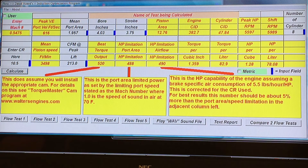In this instance we are calculating the Mach number as it applies to a high-performance, high-revving engine — whereas Taylor's original formula was for piston aero engines, which typically don't rev much past about 3,000 RPM max. This Mach number is calculated based on the compression ratio and the downdraft angle of the port, because that changes things. The program then uses this number to calculate various things: the RPM at which we're likely to have peak horsepower with the head we've just ported, the shift RPM we're likely to need, the mean piston speed at peak power, and the best torque output we can expect if the engine is built right.